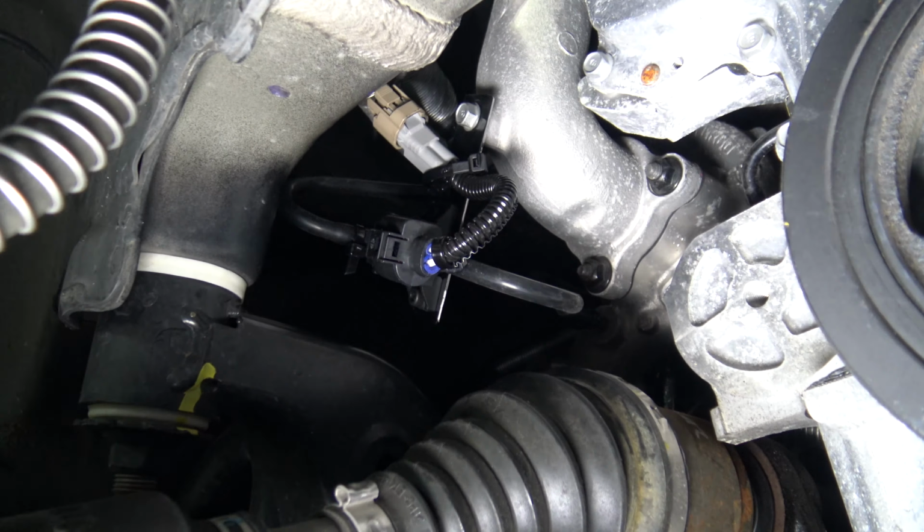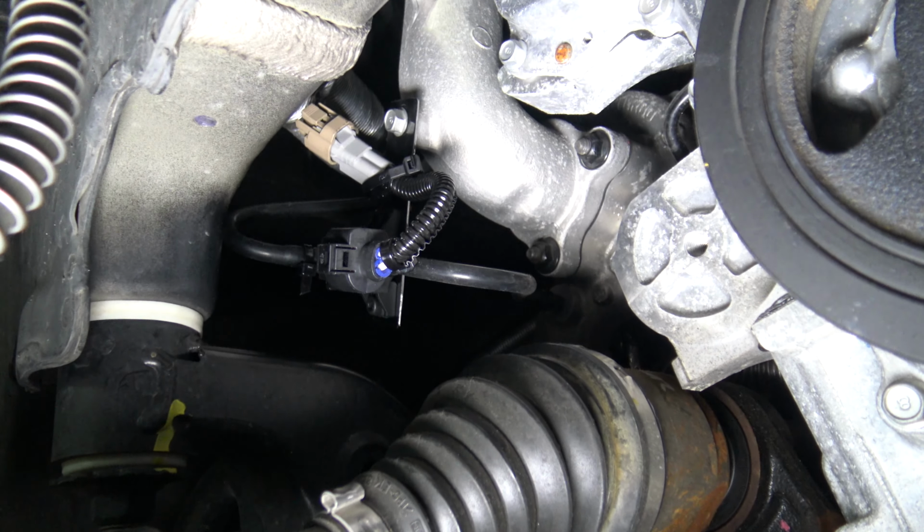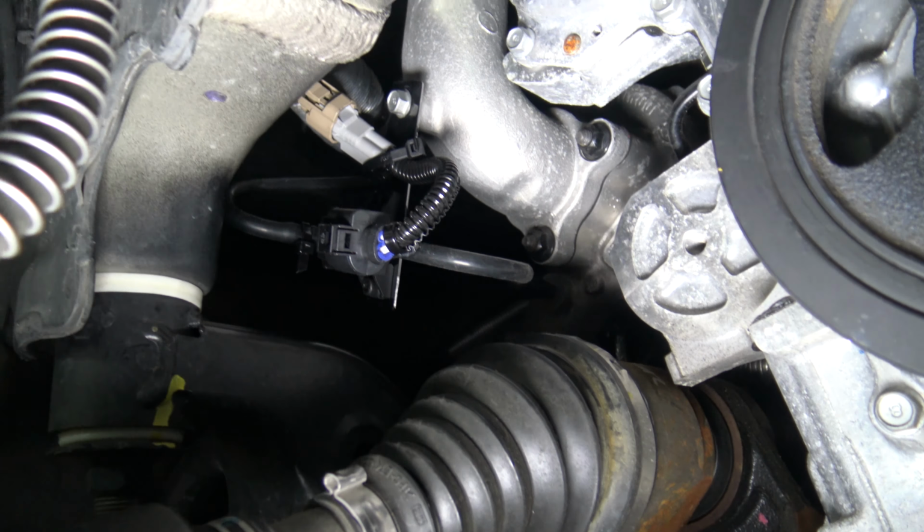and then was able to cut, the silicone tubing you can just cut with scissors. It's not that big a deal to cut it in place. And then you want to make sure that the tubing has enough slack to where it makes nice natural bends. You don't want to be putting any stress on the tubing. So you're always better off, if you're trying to cut it to length, try to go a little longer, because you can always cut more off.